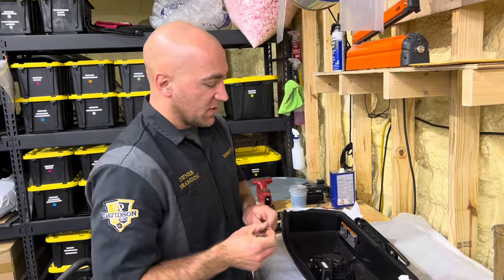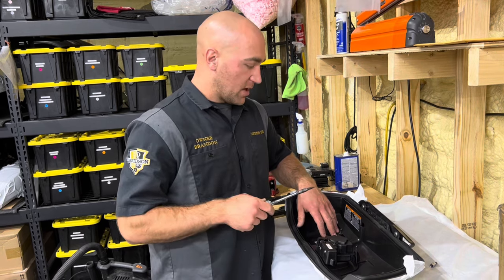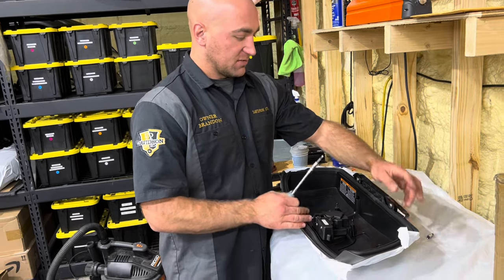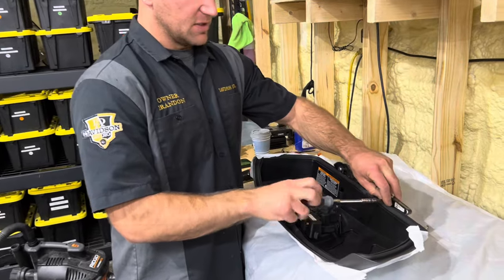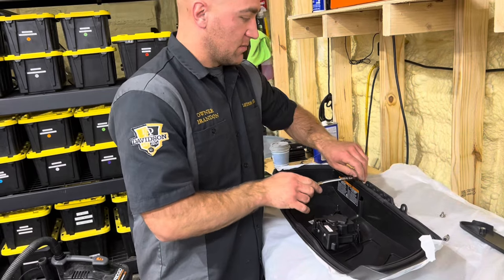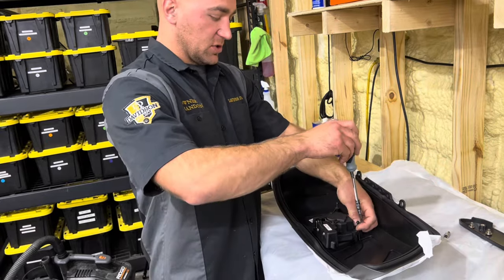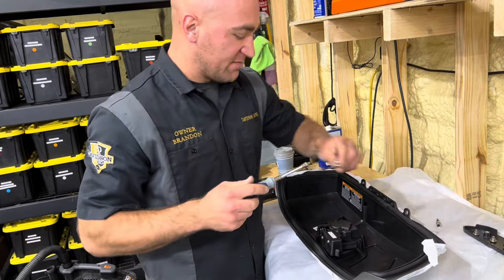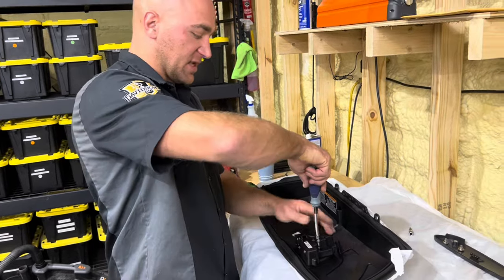We're gonna transfer the last few things off this lid, the OEM non-speaker lid, to the OEM power band 6.5-inch lid. First thing I like to do is just pull the paint protection film off a little bit. You're gonna take these two side cover hinge covers off. Simple 4mm, set the bolts aside, set that cover aside, put the bolts with it. Then this is where you can take those two limit strap 4mm off, set them aside, and you transfer over to a 5mm, because whether it's electric lock or not, there's two 5mm, one on each side.